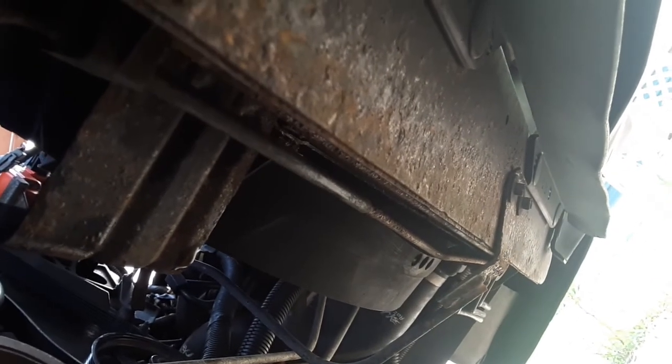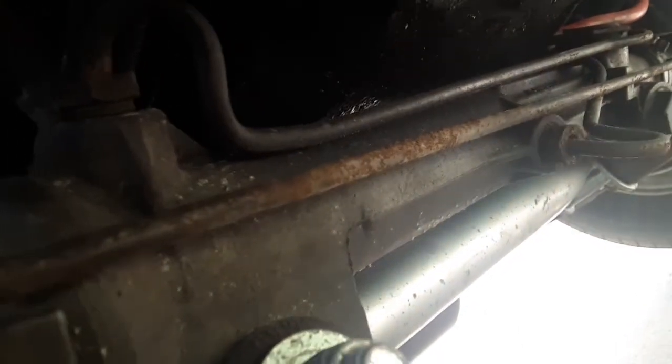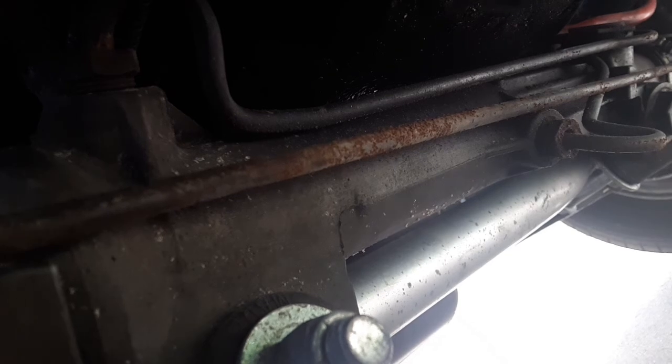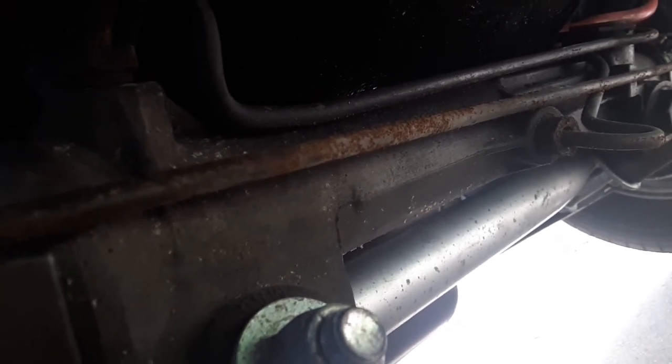So I'm going to have to wire brush that. That's all surface rust. None of it's real bad. But I'm going to have to redo all this. So that little bit of corrosion, you can see like right there on that little thing holding these two lines together, that's all it needs to start getting pinholes. And I'm pretty sure that's why it's seized on. Look at this on my rack right here. That's just a metal tube, but that surface rust, if it gets in them joints where you're supposed to be putting the tool in, I mean, you're pretty much done.